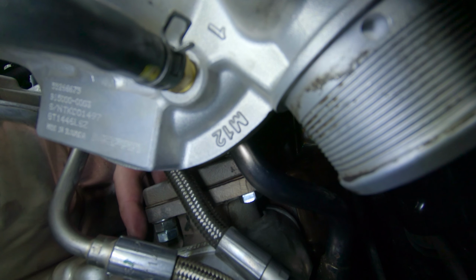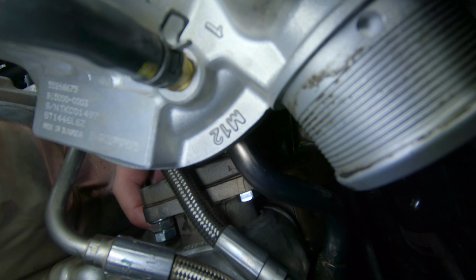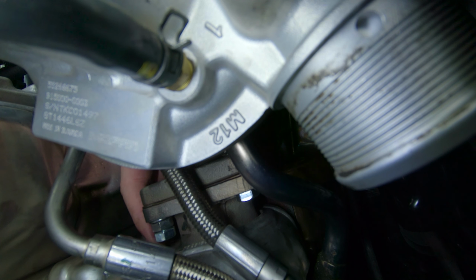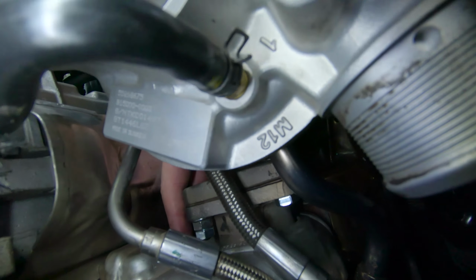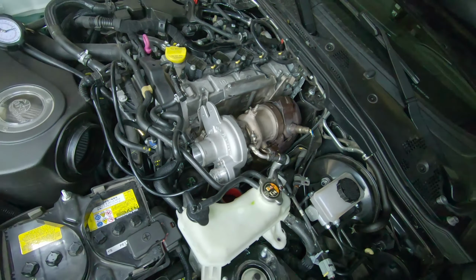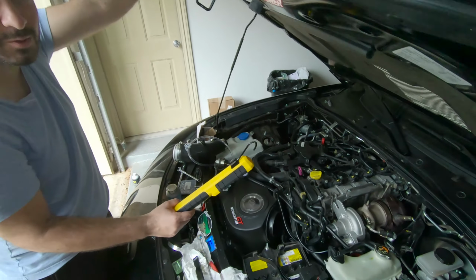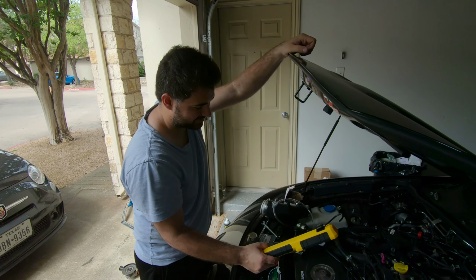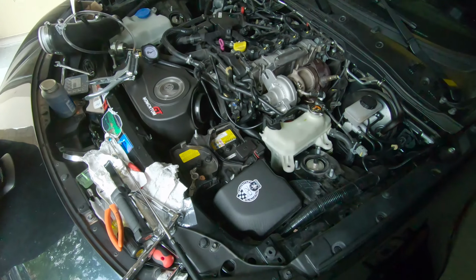So there you can see we got one of the locking flange nuts on that stud, and then to keep that nut from backing off, I double nutted it. And that sucker is tight. So that's it. That's all 4 studs, bolts, turbo bolted to manifold, should be done. Everything is dual nutted. Double nut, double bolt, triple stud.